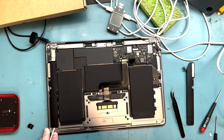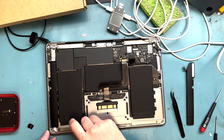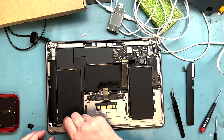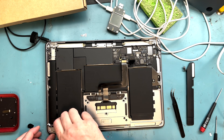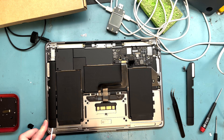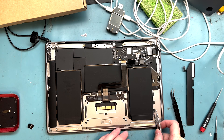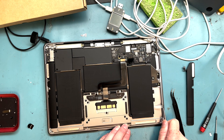Let's get the loudspeaker out from the left side. Twist it with your tweezers and pull out a little bit at a time, then twist it up again. This one ended up being a little troublesome — the pull tab broke early, so I just continued to pull it as much as I could.